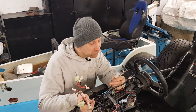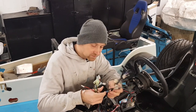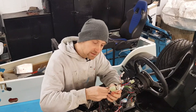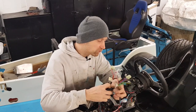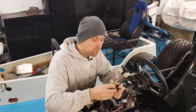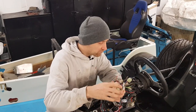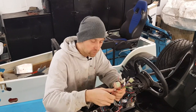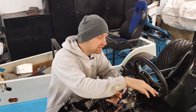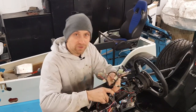We've got all these in the right area, we just need to work out what we're going to do to the switches we're actually going to use. We've also got to wire up the module to the rear fog light so it comes on as an IVA requirement and doesn't come on if you turn the ignition on and back off again. That's all pre-wired, I've just got to wire it into a main feed and a dip feed, then that'll run the rear light. So let's get those wiring diagrams back out.